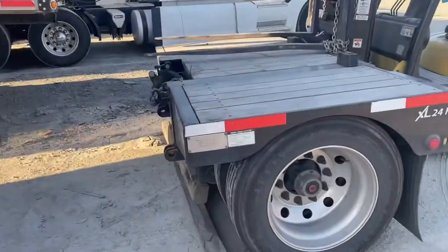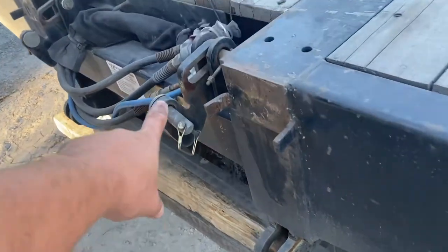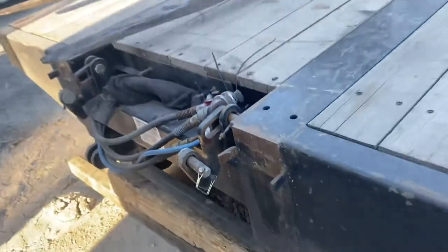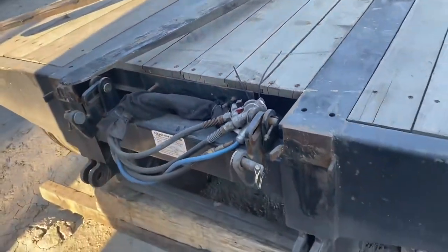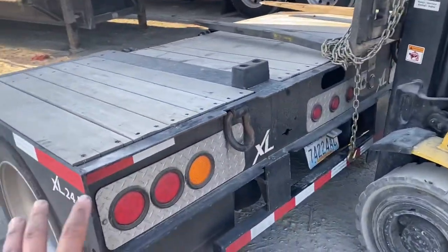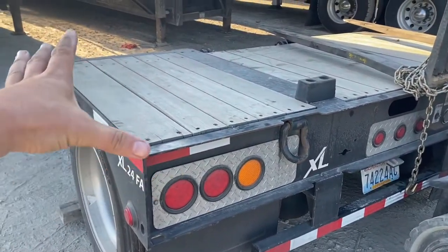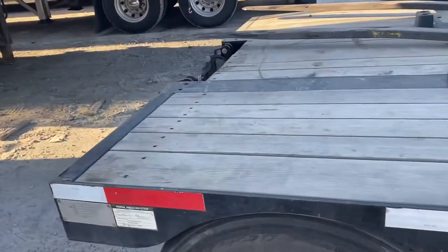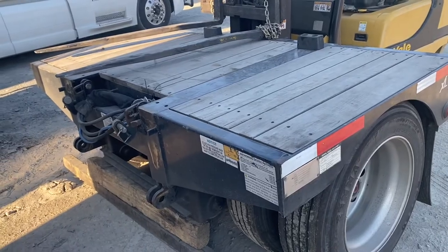Here is the third axle we're going to install. You can see it has rings that connect to the trailer and smaller ones that go into the little holes. As I said, the pressure will be at the top attachment points to hold everything together. You also have the air hoses and the electric line to connect for brakes and lights. It's almost identical to the trailer itself — just a smaller piece but the same design. If it's not identical to your trailer, it probably won't work, so that's the first indicator of compatibility.